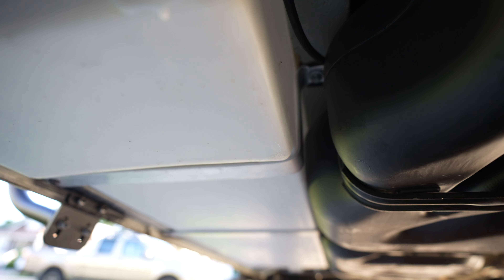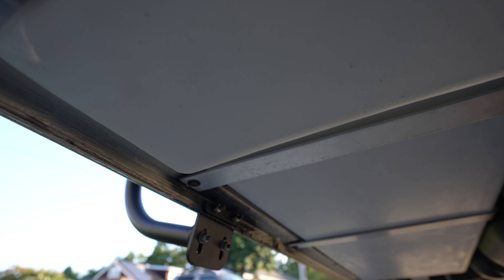The gray tank fits right next to the diesel tank — that wasn't intended, we just got lucky with the shape. I bent some flat aluminum bar and bolted it to the van using the diesel tank bolts as well as rivet nuts on the edge of the tank. It's a perfect snug fit and I'm super stoked how it turned out.